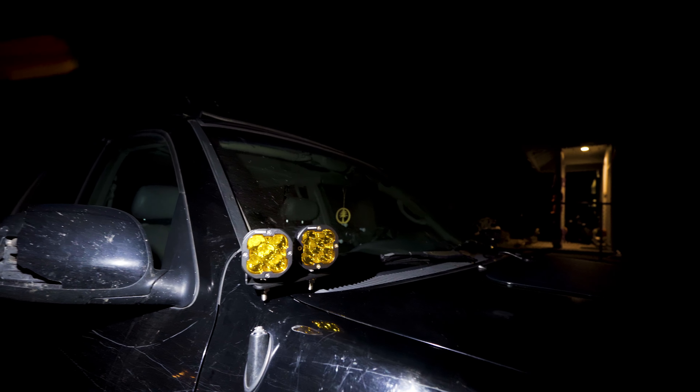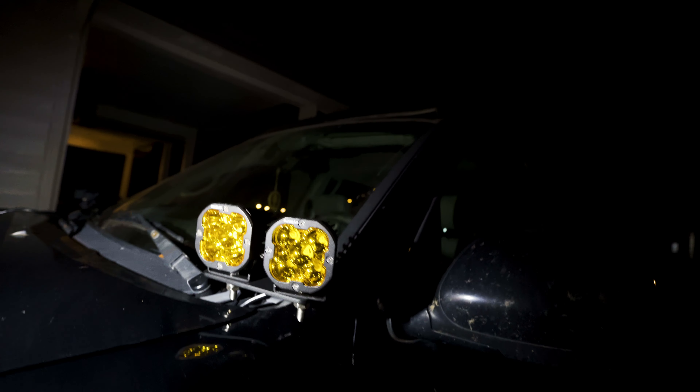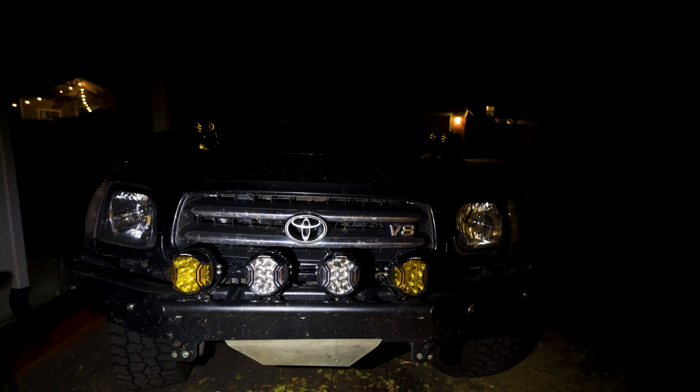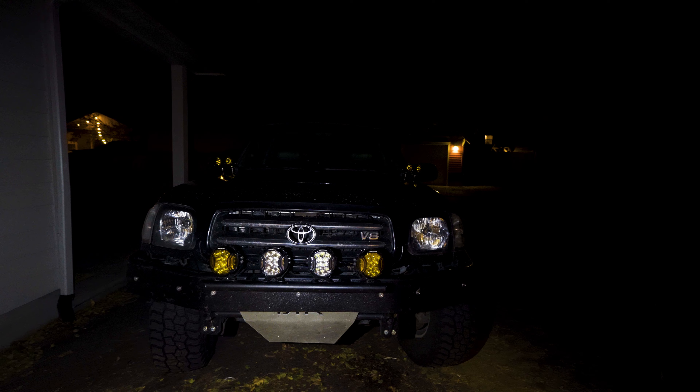Here are the ditch lights — two on the passenger side and two more on the driver's side. The next step is to actually start aiming these and getting them pointed in the right direction. The goal of these ditch lights is to fill in for the four front lights I have, which are very forward-facing. My hope with these ditch lights is that they aim towards the ditch, filling in the area to the side of the Sequoia, while those four front lights face forwards giving me a lot of vision straight ahead.